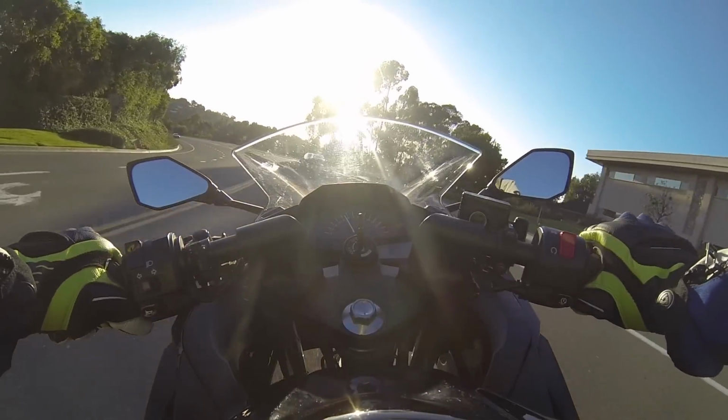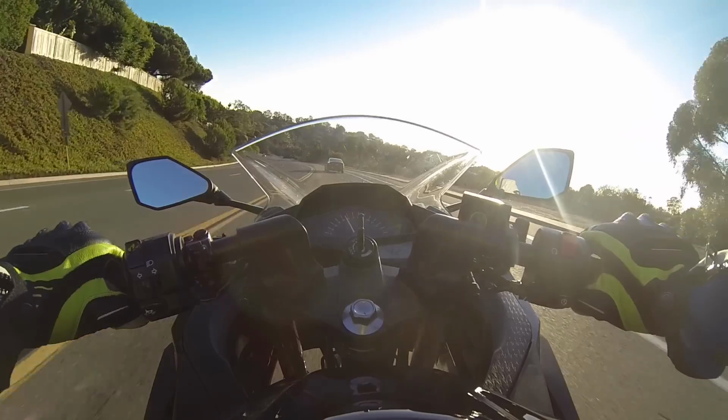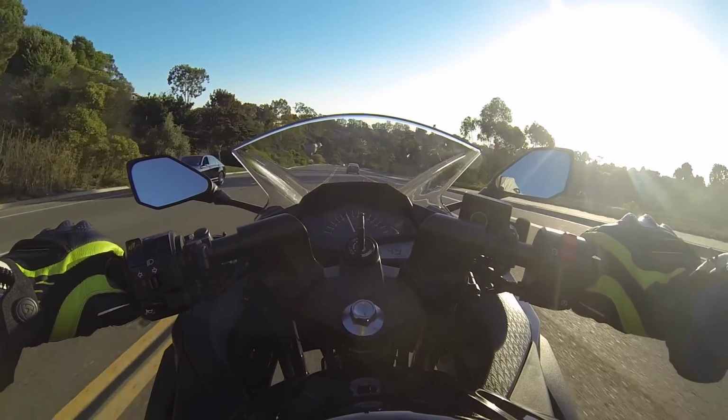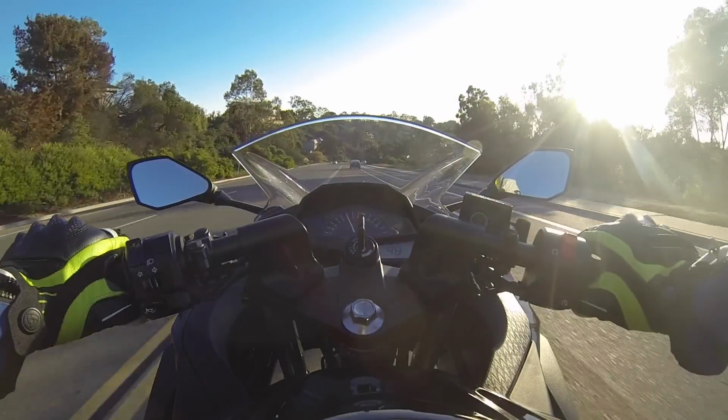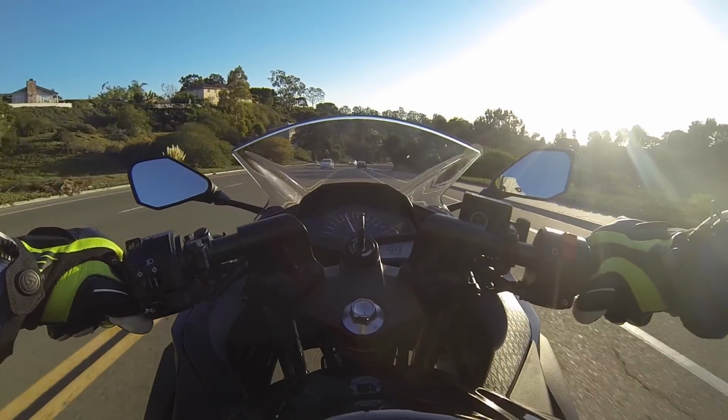When I got the bike, I did bleed both the front and rear brakes, and that helped a lot. The bike did have quite a bit of air, both front and rear. For some reason, I wouldn't say that's typical, just something I noticed after riding it initially during the break-in.